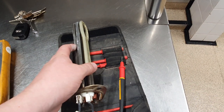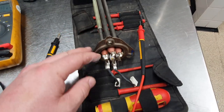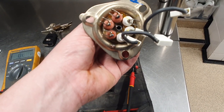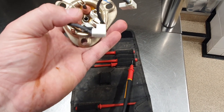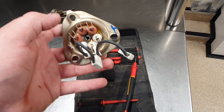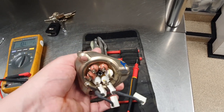At the moment this whole thing is wired up for single-phase operation. I've just taken off the jumper cables here which tie together the neutral bar, so they're all coupled together, and then at the top there is one phase across all three elements.